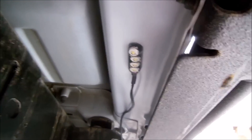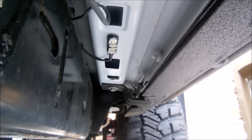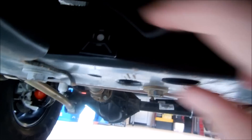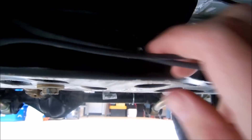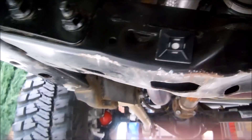Now we're looking at the passenger side lights. We're going to hook up two lights in this location towards the rear passenger side, and as we walk forward, it goes towards the passenger side front seat area. The wires are just loosely placed - we ran them up over the frame and are going to take them out the other side. Then we're going to run these wires across the crossmember, attaching them to the crossmember over to the driver's side.